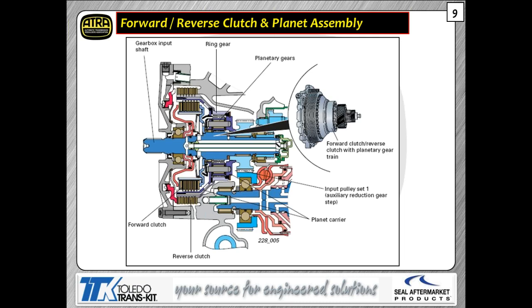In order to get those pieces apart, in other words, to take the shaft out of that cover assembly, you have to make sure you take the snap ring out. So that means anytime that this thing has got to be pushed apart, you're going to have to make sure you got an extra seal laying around because you're going to have to replace the seal. So that's one of the little quirks of this system per se.